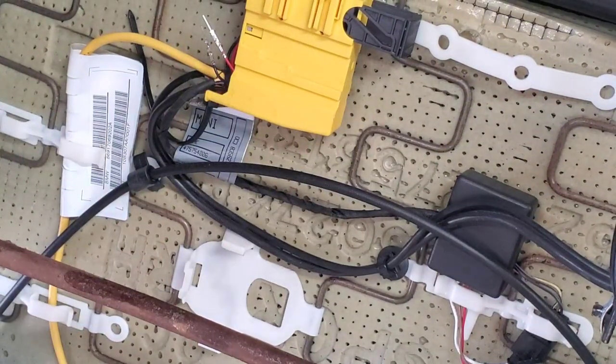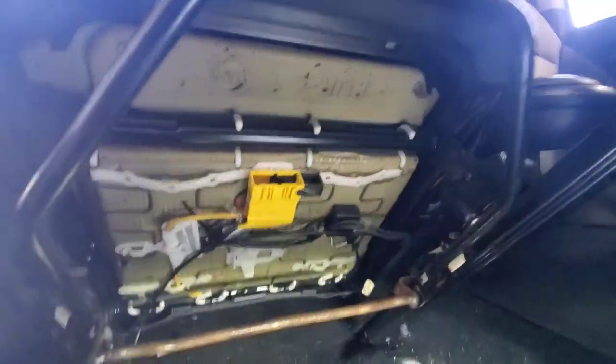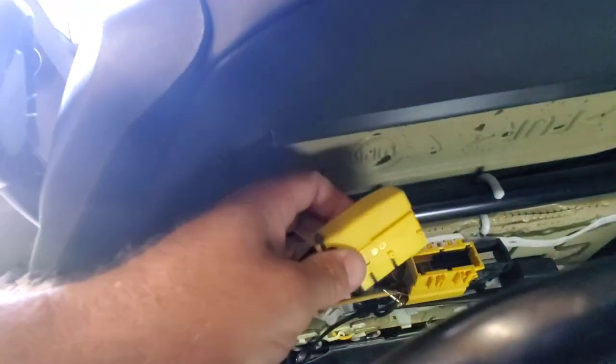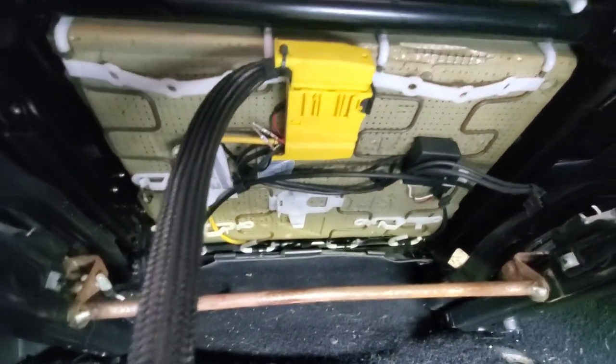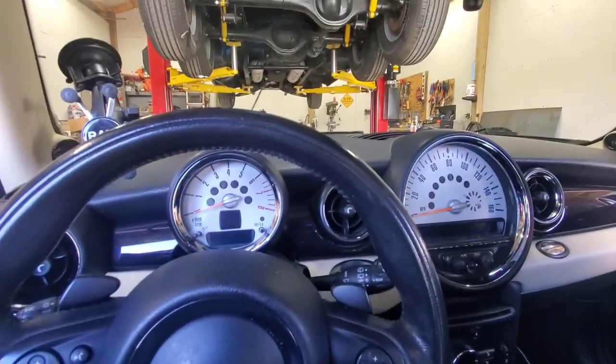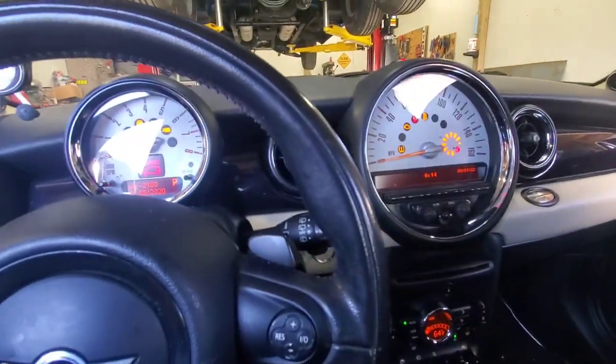We're ready to put the seat back in the car. Get the connector back close enough to reach it — it's hard for the camera angles and hard to do one-handed. Put the yellow connector back in the slot and then press on the black part to lock it back in, then bolt it back to the floor. Before I get too far ahead of myself, I'm going to go ahead and try it before I bolt the seat back down and see if it helped anything.